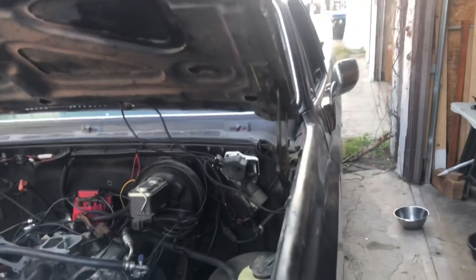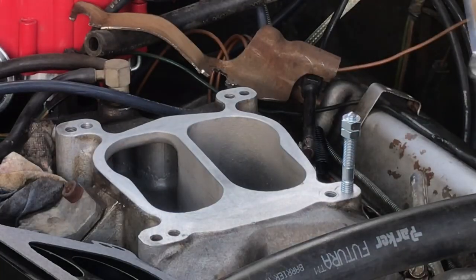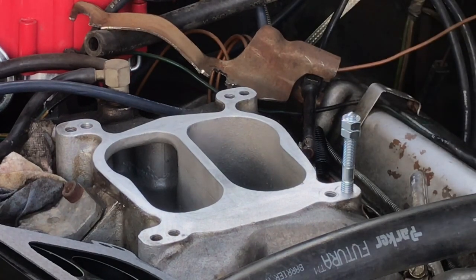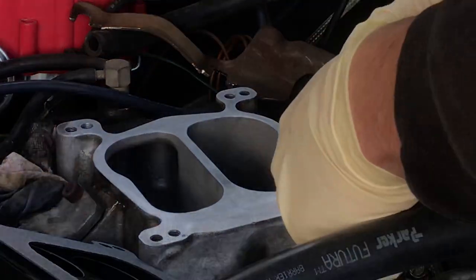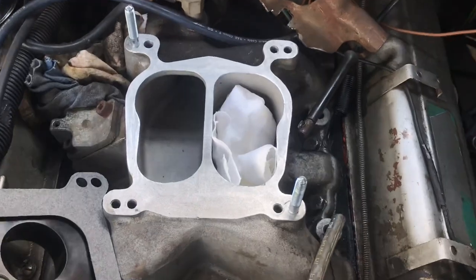So there's a deadline for everything — I just had to push this out of the way; this guy had to get out of his garage. Gotta get this done. Now these new studs don't have an Allen head on top, so just use the double nut to get them started. Oh, they're not half inch — it's the 7/16, that's why. I think they're probably 13mm — this is a little loose. So they are 13mm; that's where the wrench wouldn't fit.